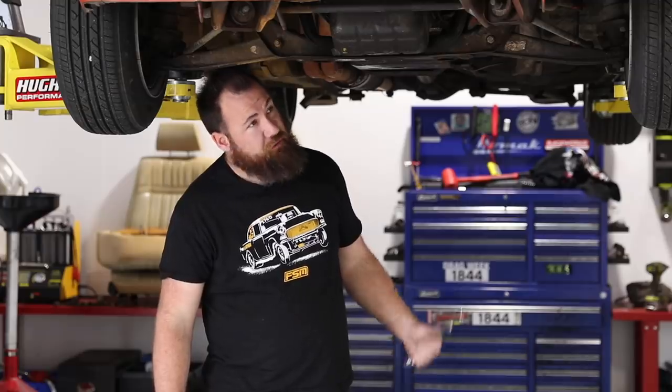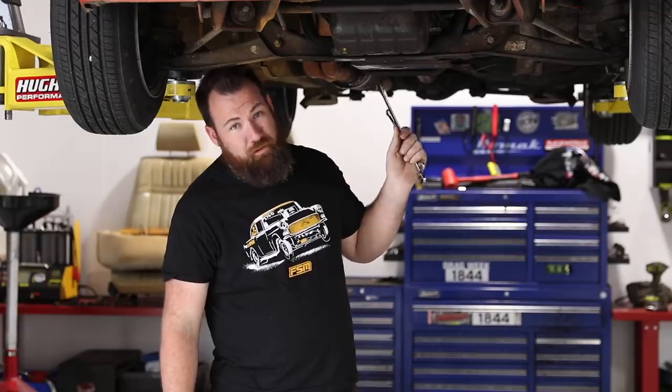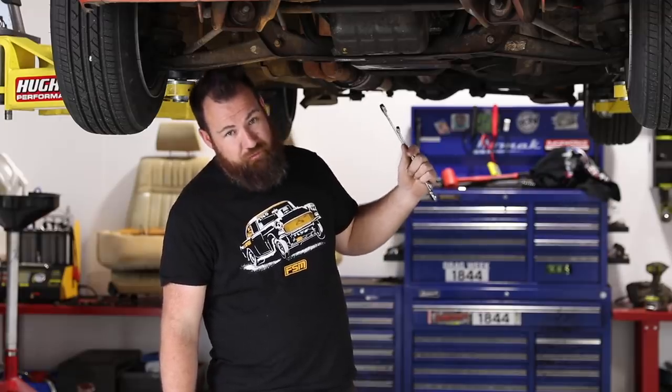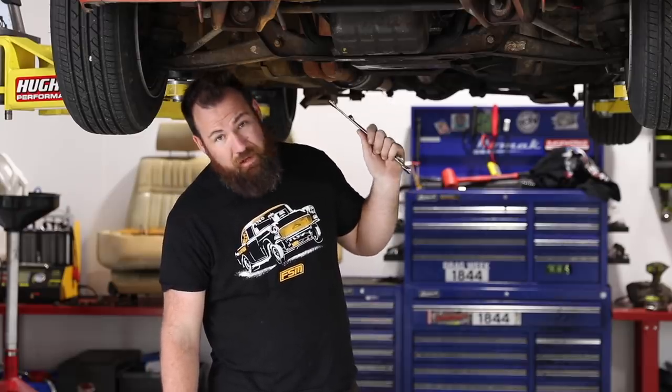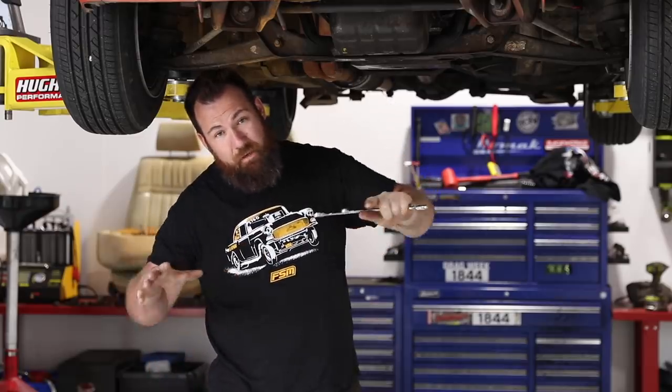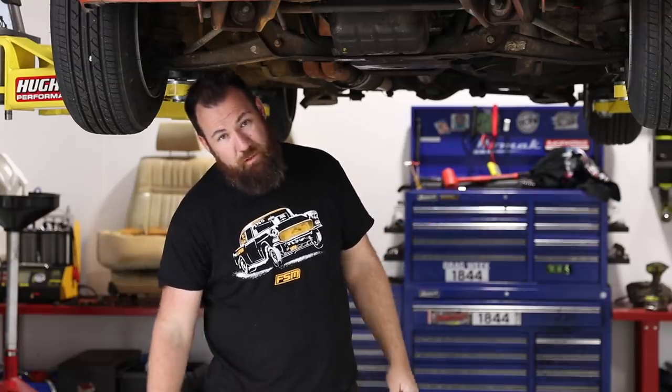You may be wondering why I've got the car back on the hoist halfway through doing the carpet. Just looking at the floor pan, I've decided to actually just pull the transmission shifter out. It's literally just one bolt on the bottom and a couple of screws on the top, and that's going to make it so much easier in actually laying the carpet in. We're not going to have to try and wrestle it over the top of the shifter and guess where that shifter hole is, because